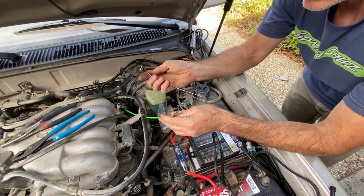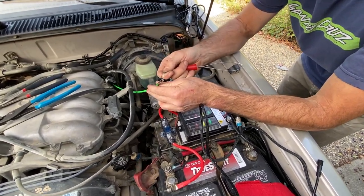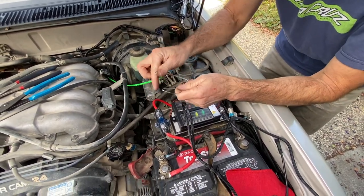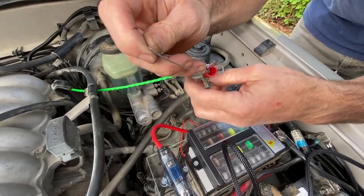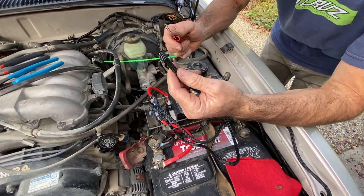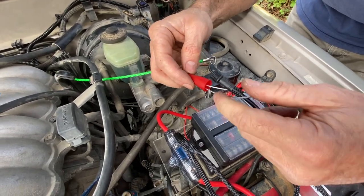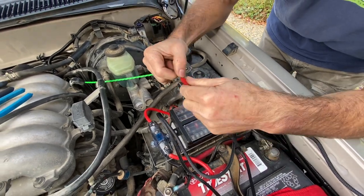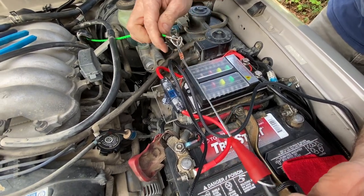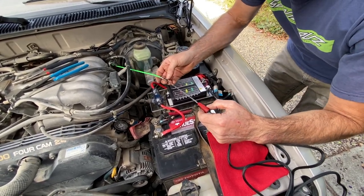Using a wire feeder set I bought on Amazon, I figured out how to use the little connectors — you just girth-hitch the wire, feed it in and loop it through so it's captured. The male end goes through the firewall, and I put a plastic cone head over it to pull it through. I got inside the rig underneath the dash and my helper Wei watched the wire feed through from the engine side. It went through pretty easily.